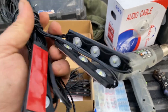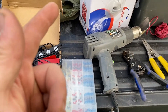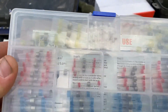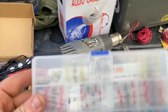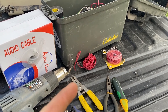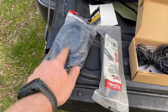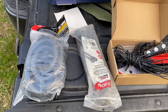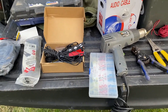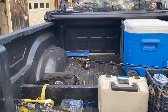Test the lights on a drill battery to figure out which side is positive and which is negative, because LEDs are polar — if you put the negative to the positive they're not going to work, unlike a halogen which works both ways. I got these connectors I'd never tried before; they're a shrink wrap tube with a solder ring inside, so you slip the wires in and hit them with a heat gun — they melt and create a watertight seal. The wire will run from the driver's side door where the dome light source is, under the truck, protected by wire loom and held with zip ties. You'll also need standard electrical tools like strippers. I've got to clean out the bed and remove the tonneau cover for easier access, then we'll start running the wire from the front.